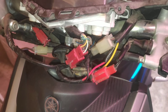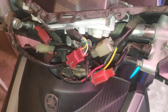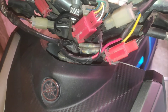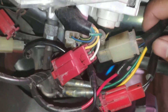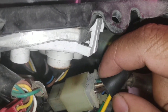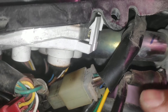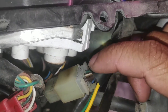Now for those having difficulty, I'll show you the connector here where the wire from the flasher relay passes through going to the turn light switch. You just need to find those wires — it's very basic. The wires we need are: the green wire and the brown wire — those are for the turn signal lights — and the brown-white wire, which carries the supply coming from the relay. That's what makes the current flash, which is why the lights flash too. We'll be connecting to those three wires.